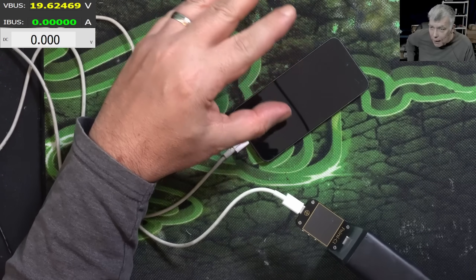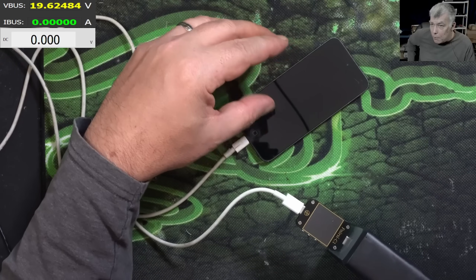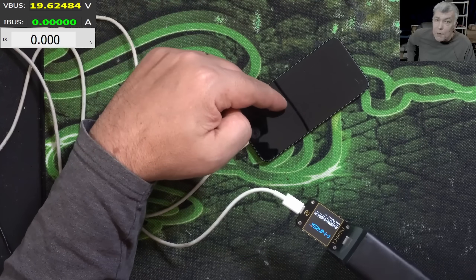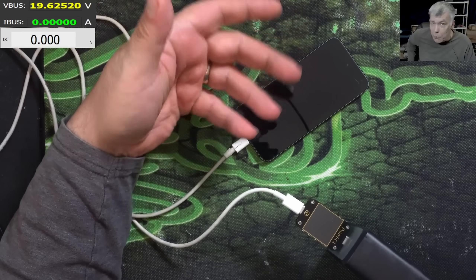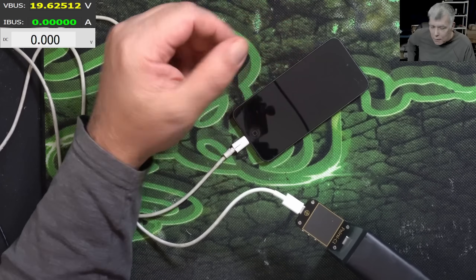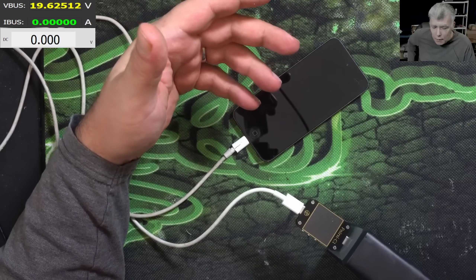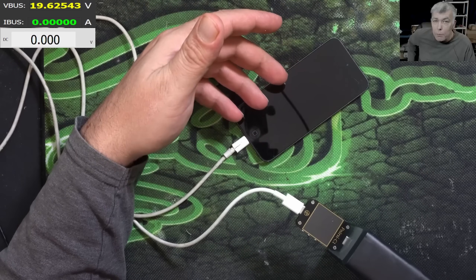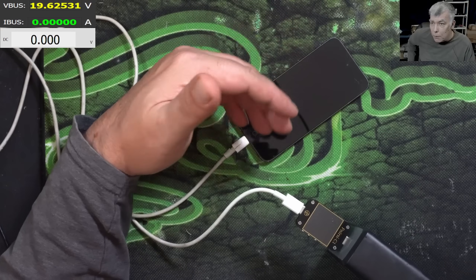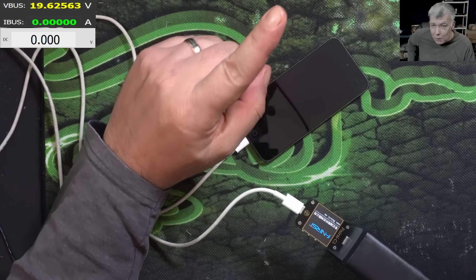This was the most common problem with iPod and iPad, but also with any tablet that has a replaceable battery. What is the difference between this battery and a laptop battery? A laptop battery will get locked — you cannot replace the cell, so that battery can never be used. But this one is made to be replaced, so the device cannot lock the battery or the circuit. Over time, batteries get used, and when the battery is used, not only does capacity go down, but resistance goes high. When you have a battery with high resistance, the charging circuit tries to push current but the battery takes no current and will not charge — like in this case. I'm pretty sure this iPod is good and the only problem is the battery.